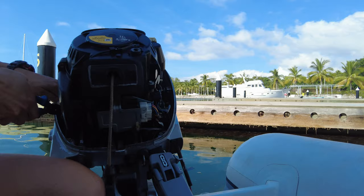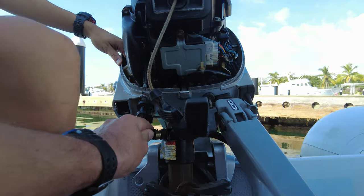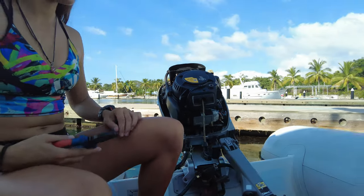What we do have here is a fuel water separator from a Yamaha. I suggest you add a fuel water separator before every outboard engine. It'll save you a lot of hassle with cleaning out your carbs all the time, because fuel does get dirty.